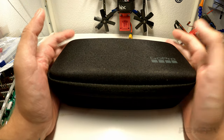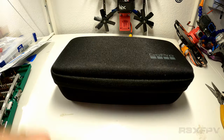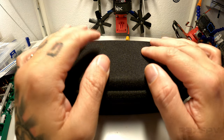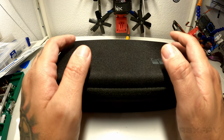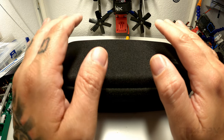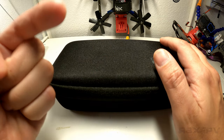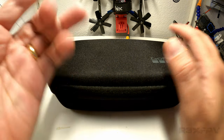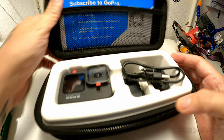And I originally did the whole thing with the unboxing and breaking the strip and everything so you could see it was new, but my LED lights in this room, which is this one here, and that one over there and everything else, make a weird flicker on the GoPro 9, which is quite interesting because the GoPro 9 has a 50 Hertz and a 60 Hertz option, which makes deflickering possible. So you don't see that flicker on the GoPro 8, on the GoPro 7, on the GoPro 6. This is not an issue. On this GoPro 9, it's a huge issue. The only remedy I could do was lock this GoPro's shutter speed to 30 and also film in 4K 30, and now it sort of works. So, I already did the whole real unboxing, but it didn't really work out.